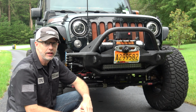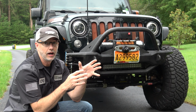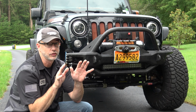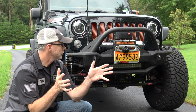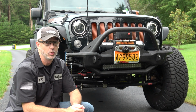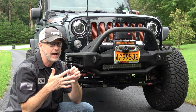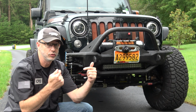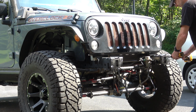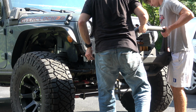It went pretty smooth. I will say, I don't think it was as smooth as the rear bumper. So I had to remount my vacuum pump. I could have relocated that, and in hindsight, it might have been better to relocate that, and I'll tell you why here in a second. Everything else, when I put the bumper on, the studs lined up perfectly in the holes, but from the backside, putting the bolts through, there were a couple of holes in the frame flange that didn't quite have the room I needed to get into the bumper. So I had to widen out a couple holes. I had to put up the bumper, look, take it down, do a little bit of hole enlargement, put it back up, check it, take it down. I did that a few times, not too big of a deal.